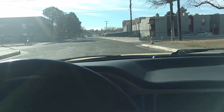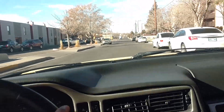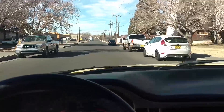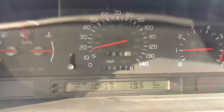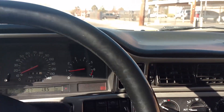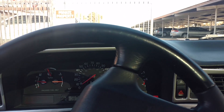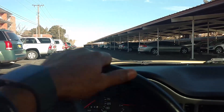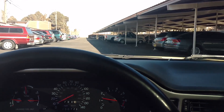The boost just isn't stable. Doesn't seem to be putting out good power. It does feel aggressive sometimes accelerating, but it's not stable. And my gas mileage hanging out down here around 19.5 is the best I've been able to get with it. On the highway I get about 25, but I should probably be getting close to 30 in this car. So I'm going to go disconnect the battery, swap out the ECU, and drive it around until I tune it with the stock ECU — see how it performs.